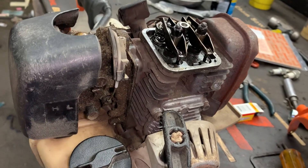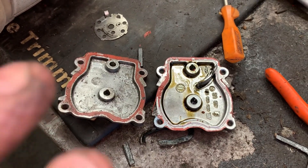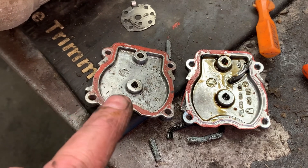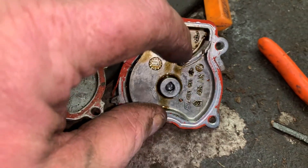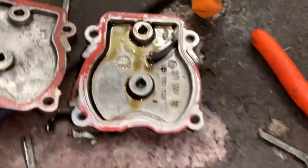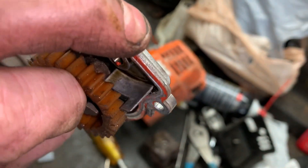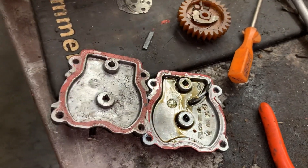It works great when they're running. If you remember my previous videos about some melted camshafts — Stihl has listened, probably due to numerous warranty claims. They have changed this back cover and it's got a ramp now, or a funnel if you will. When this engine is running, it's directing more oil right on that camshaft lobe — basically dumping the oil right on that camshaft lobe. I think this is going to be the answer to our issue with melting camshafts.